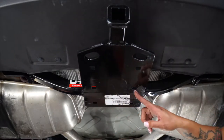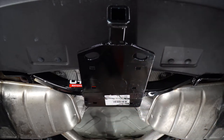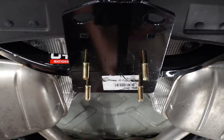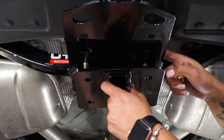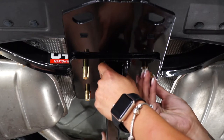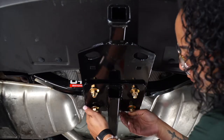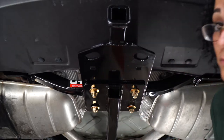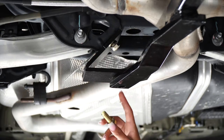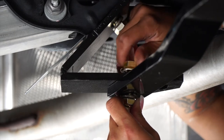As you can see, this hitch has six holes, but we're only going to use the four most forward holes. We're going to take our provided carriage bolts and drop them in, then raise the center piece into position. Take our flange nuts and give them a turn. Back at the bolt-on bracket, align the center piece with the driver's side hole, take your provided bolt going upward, and fasten the flange nut on top.